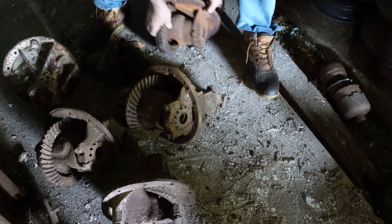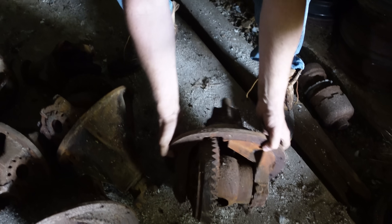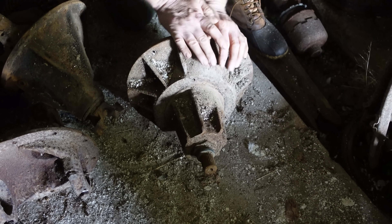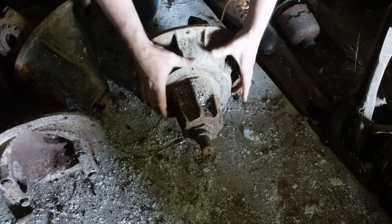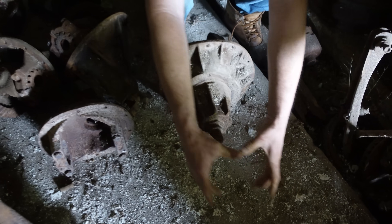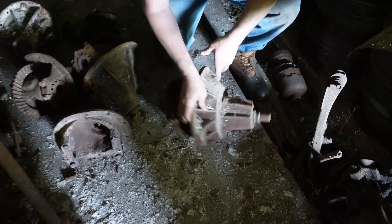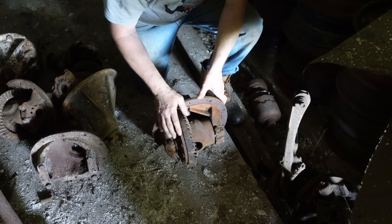And this thing here — Buick, crazy but true. Buick had their own differential, this monster right here. You might say it's the same thing — well, not really. If you look at it, it's kind of flat and weird. This is Buick's torque tube. This flat plate right here would take a bolt-on tube which would have a drive shaft inside. There'd be a steel tube going all the way up to the back of the transmission on this torque tube Buick, and this would be Buick's specific rear differential.